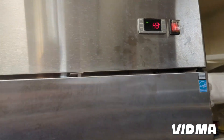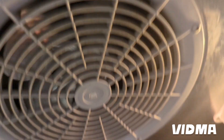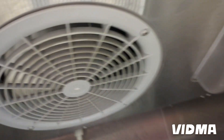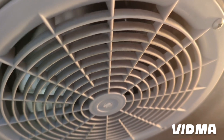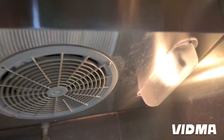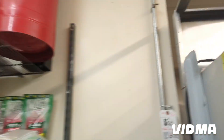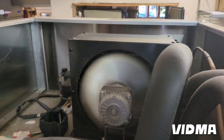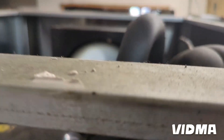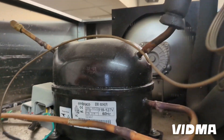Okay, so the fan is actually spinning — if you press the door button, the light goes out and the fan is working. Let's go back: there's the compressor, little guy. There's a condenser fan that's spinning, but one of these fans is not working properly. The compressor is probably running all the time.